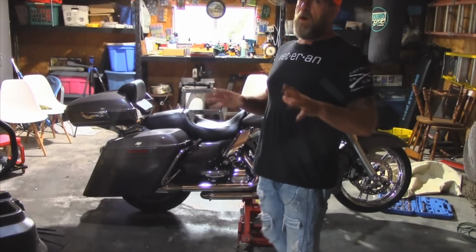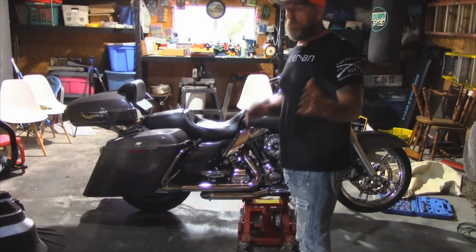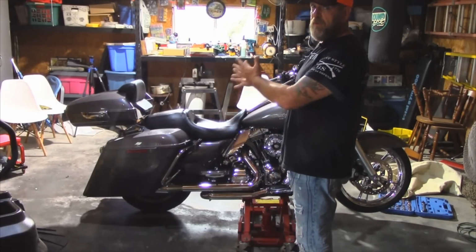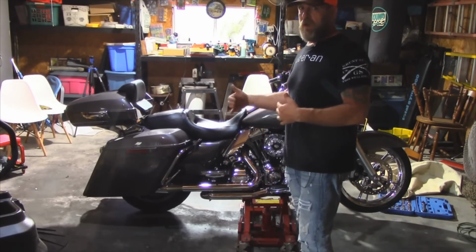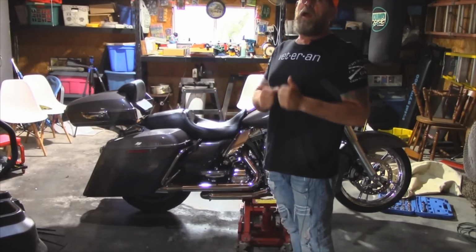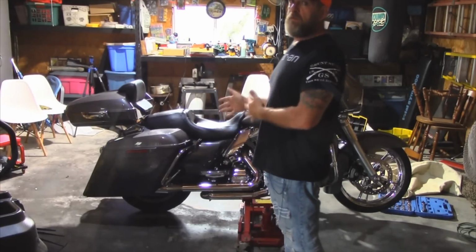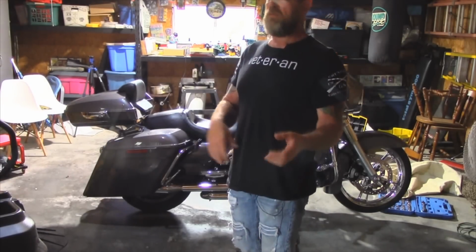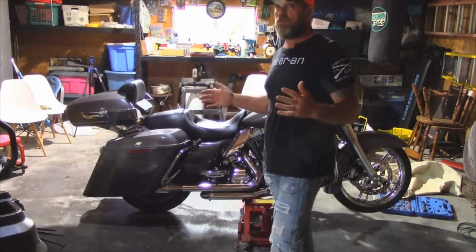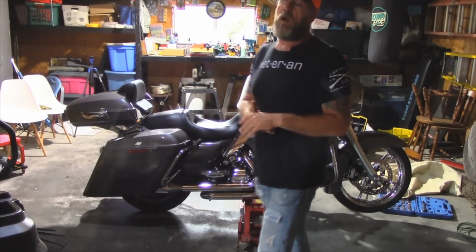So no options on moving the exhaust if I want to keep true duals, which I do because I already have cut out bags and fender and stuff like that. I don't want to run a side pipe because I've got too much money invested in my bags as it is. Now, the one thing I had to do that I kind of questioned at first was adding lowering blocks with the air ride. I've seen it in forums and I've seen people say, well, if you blow a shock, now you're sitting on your tire. Or if you blow an airline, you're sitting on your tire.